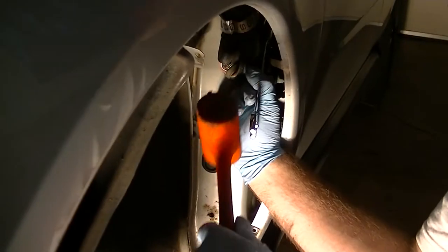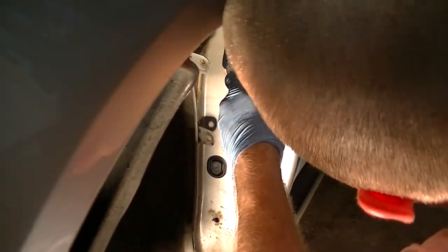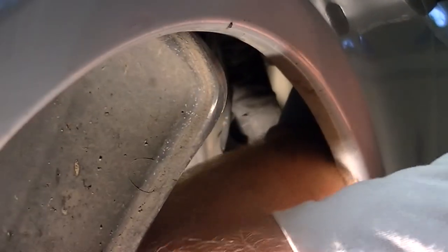You'll find when you're putting the top bolt back in on the Turn-in Concepts piece, you'll need to use the open end of the wrench. You may have to give these a couple of taps to get them loose. You may have to take some patience with getting these undone. You definitely shouldn't have to take the fenders loose to get these, at least the Turn-in Concepts ones.